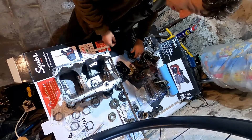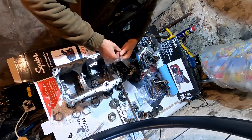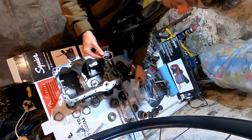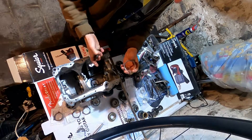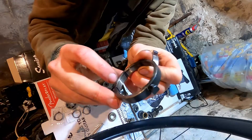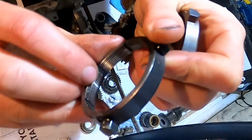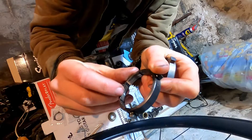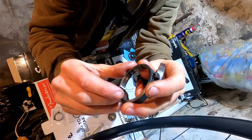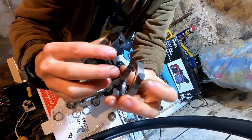Another reason is when I was shifting into second gear, especially downshifting from third into second, it would crunch. Tried to double declutch it — sometimes it would work, sometimes it wouldn't. It's because the synchro rings were worn. This is the synchro ring from second gear, and especially on this last edge, it looks more worn than the rest of it. It's not much because it worked okay at low speeds. So all the synchros are being changed — everything's being changed really. And this is a new one for comparison.